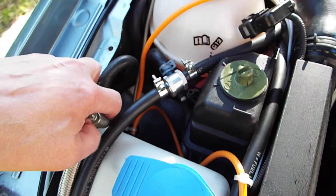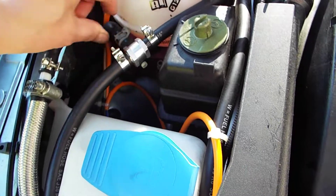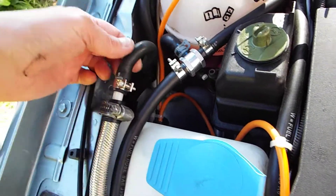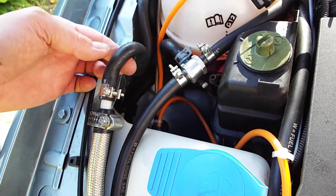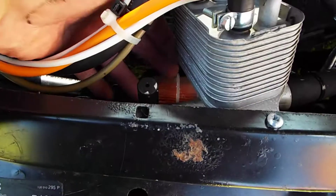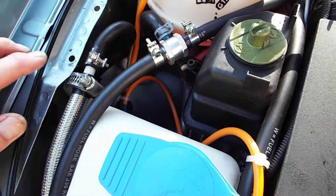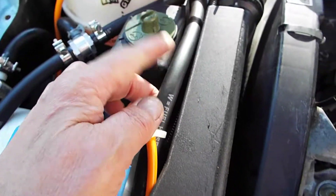I've taken out what used to be the diesel filter that sat here. That was the diesel return, which I no longer use, and this is the diesel fuel main supply. I put vegetable oil in the main tank, so this is my main vegetable oil supply from the main tank. I've got another filter fitted here. I've got a small tank in the boot which is full of diesel — this is the supply from the diesel tank, and underneath I've got a little disposable filter for the diesel. I've fitted a little non-return valve as well, and we've got a return pipe here.